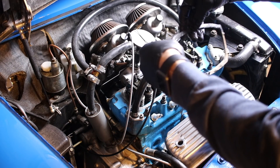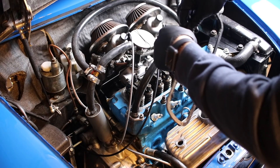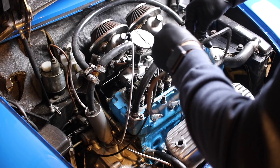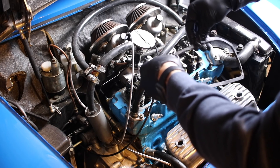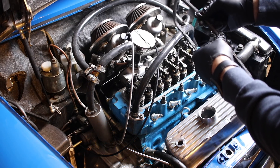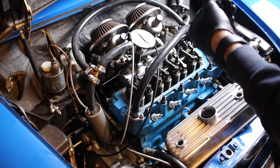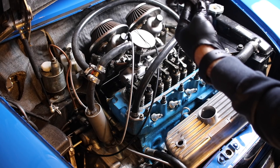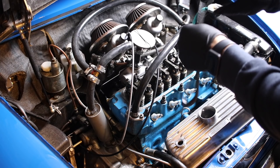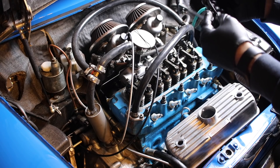As you can see, I'm not globbing this stuff on here — I'm just getting enough on there to make a nice seal and a nice adhesion surface for your gasket to stick onto the valve cover, and then for it to stick onto the cylinder head. I usually like to cover all the way around the edge as well, just so it's black and looks nice. Doesn't look like you've got a big piece of cork in between. Although, the cork doesn't look that bad. You could be using orange gasket sealer — please don't do that. Looks so bad.